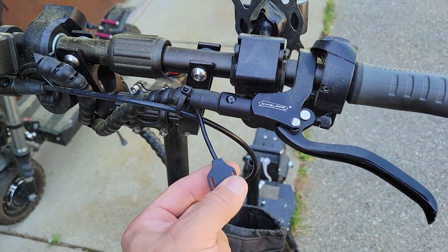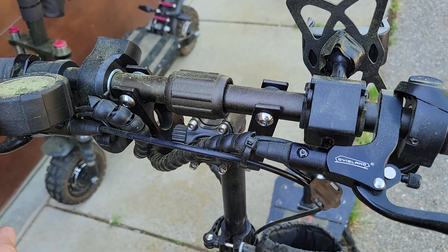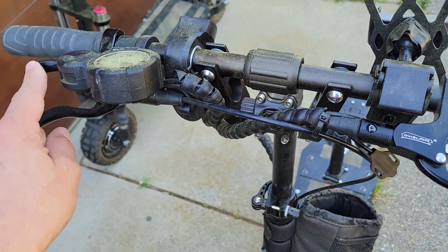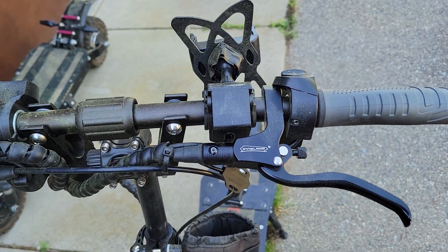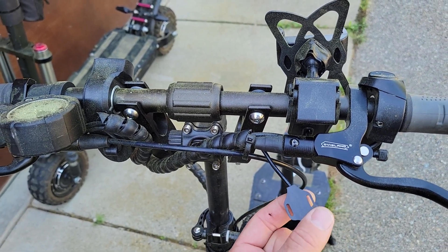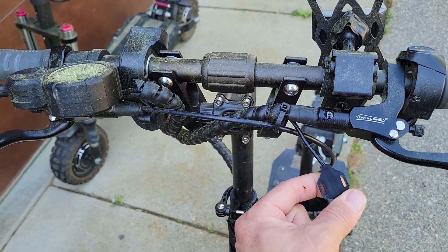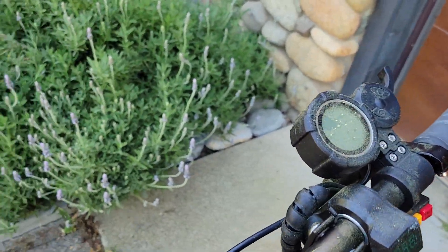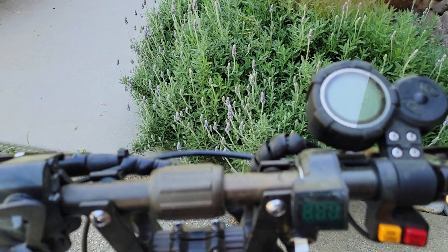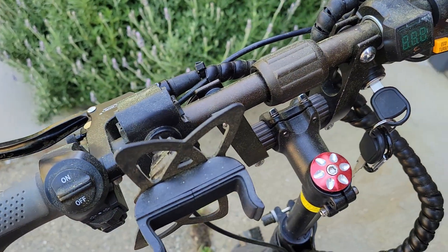So now you have a choice. You can either keep this disengaged, which will also disengage your throttle safety — so when you pull the brake and continue to pull the throttle at the same time, you have two competing systems. The throttle tells the scooter to go; the brake tells it to stop. However, of the two options — having unpredictable grabby brakes due to regenerative braking you can't adjust versus letting go of the throttle when you're braking, which seems pretty intuitive — I think it's more important to have safe, predictable brakes.